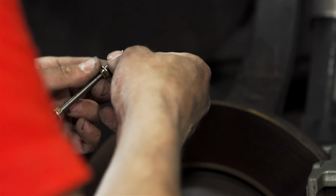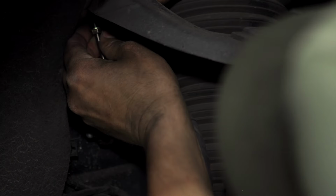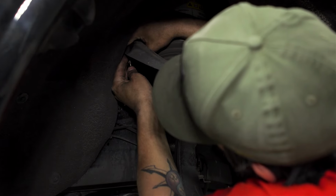cause a lot of commotion. You can hear it inside the vehicle. It's a little off-putting. So Offroad Animal has made some new rear shock lowering brackets. These brackets lower the rear shock by 30 millimeters to match the raise in height of 30 millimeters from the links. That way you're not going to get the rear shocks knocking and causing commotion inside the car. We're still working on something for the front, likely a strut top spacer.